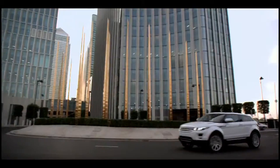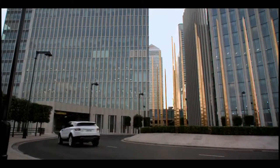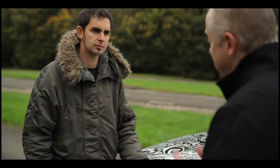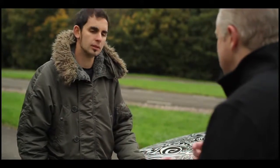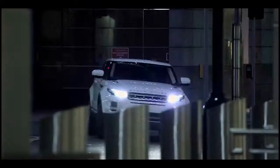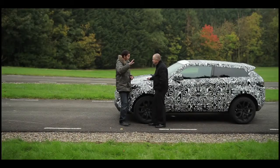Also, because the car's got to be agile, we run about a 14.5 to 1 steering ratio, which is the quickest in its class. That means 14.5 degrees up here on the steering wheel gets you 1 down here, but obviously that could make it nervous at speed. So what EPAS allows you to do, more than any hydraulic system, is change the damping and the inertia feel, you can change the efforts, and when you press a button, which is really hard to do with any hydraulic system.